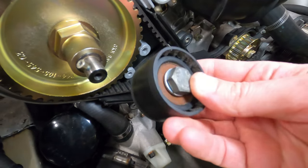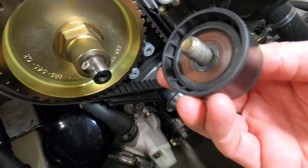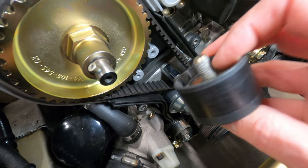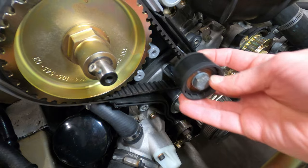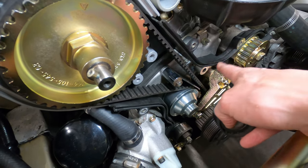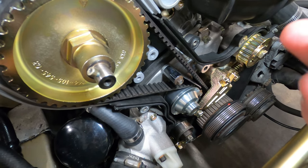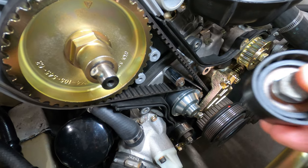And last thing we'll do is put in a little idler roller. This bolt is tensioned again to 33 foot-pounds. And I like to put a little bit of blue Loctite on these because when I first got the car, this bolt actually backed out and made contact with the belt and got launched up here and wedged in between the belt covers. So I got lucky that it didn't tear anything up, but I like to make sure these are nice and secure because of that.